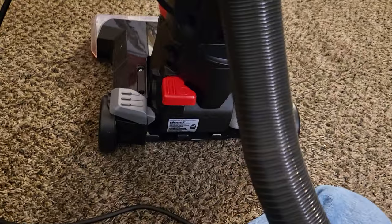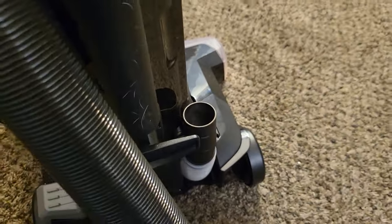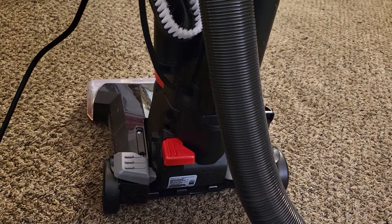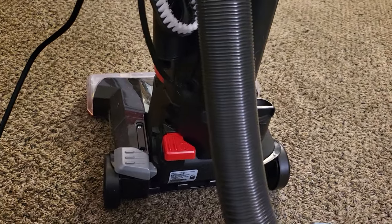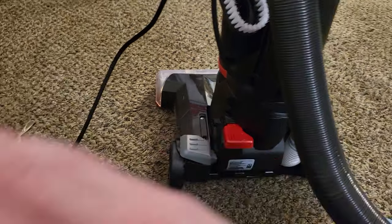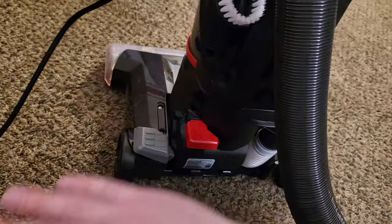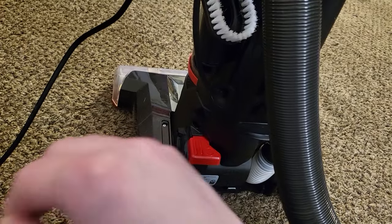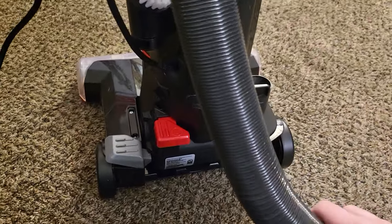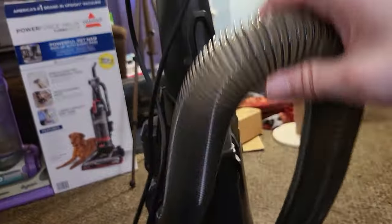Now, a lot of people have complained of Bissells in the past, of leaving the machine in a certain spot on carpets and using the hose, and then having debris get shot out of this lower hose and all over the vacuum. Now, I do have that problem once in a while, but for a while, whenever I was actually using these machines, I never had that problem and didn't really understand why people were complaining about it, until I then did what I assume a lot of other people are doing, and I would park the machine in a space and start using the tools without vacuuming the carpet underneath, and that's when it started spitting debris out. So make sure to vacuum the carpet before you actually park the machine in a spot to vacuum your couch or whatever else the case may be, because if you do that, there's not going to be any debris for it to kick up into the brush roll and spit out this hole. So as long as you do that, you should be okay, and that shouldn't be a problem. Of course, again, when you're done with this, clip it up here.